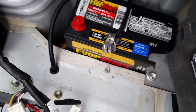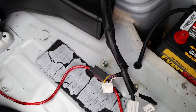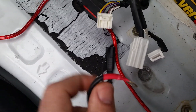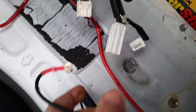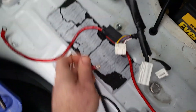I also have a charge connector for my battery charger that I hook up every now and then. The positive end of the charge connector ring wasn't big enough to fit around this new, fatter post. The trick: just snip it, then expand it out and it'll go around where you need it.